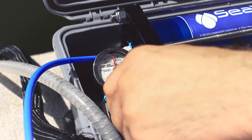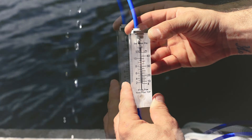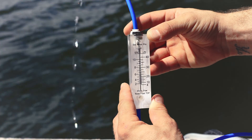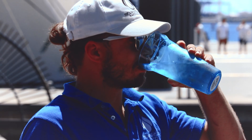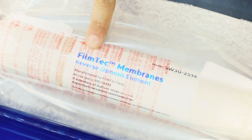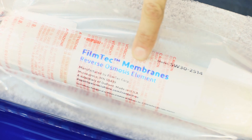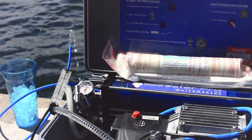Remember to take your time when increasing it. You will be able to observe the water flow indicator connected to the blue line — this is your drinkable filtered water. This will measure the amount of water being produced in GPH, gallons per hour. Our American-made standard Film-Tec membrane filters are designed to last about 3 to 5 years and are available to purchase on Amazon.